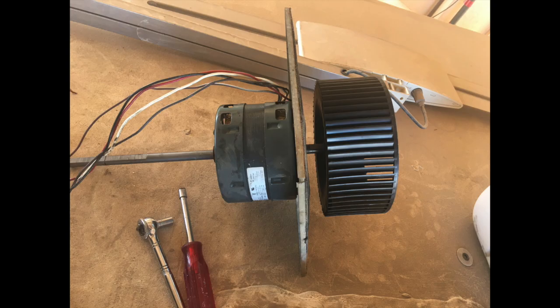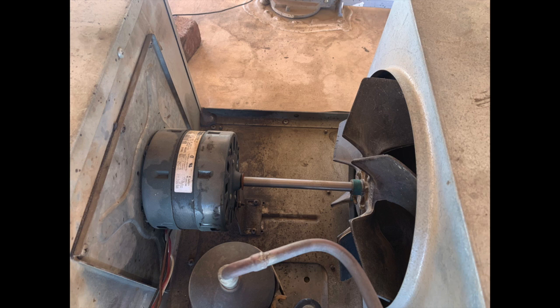I decided to remove the motors from the unit and take the motor apart to re-oil the bearings. It was not as difficult as I thought, and here is how I did it. First, I had to remove the motor from out of the AC unit. Observe common sense safety measures and make certain all the power is completely off to your AC unit — turn the breaker off and also turn the unit off at your thermostat that controls the AC inside.